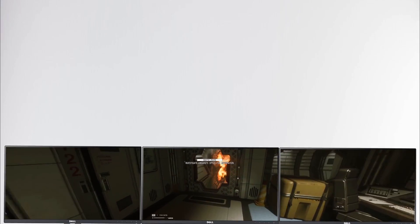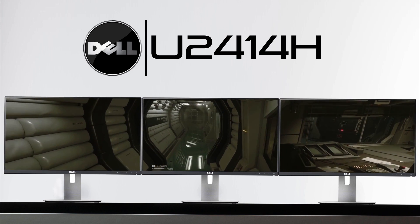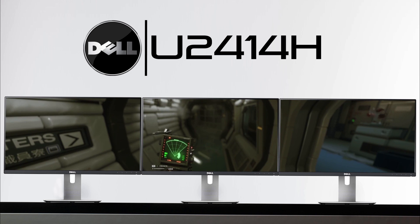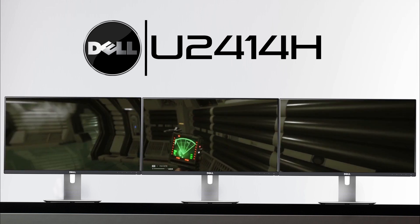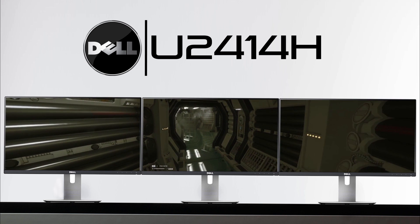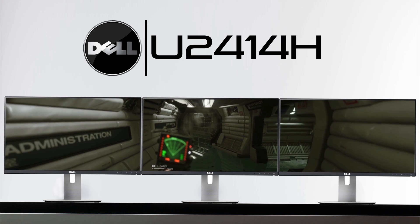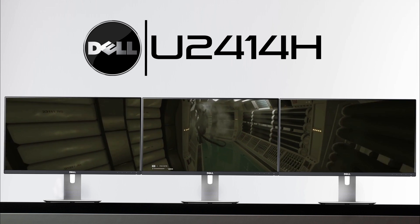The second 24-inch monitor is what I think is probably one of the best monitors out there: the Dell UltraSharp U2414H. There's also a U2415H version with a 1920 by 1200 resolution, but the U2414H is 1920 by 1080, which I think is a great resolution for that screen size. It's IPS LED backlit like the BenQ, but unlike the BenQ it has a full DisplayPort connection as well as a mini DisplayPort connection — great for Apple users with Thunderbolt. It also has a VESA mount so you can mount three of them to your desk or wall, giving you great versatility with a very thin bezel and clean design.